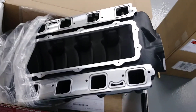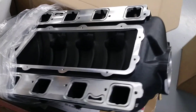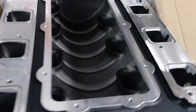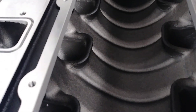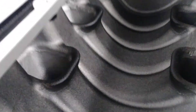What is happening everybody? For you guys that have not had a chance to see the inner workings of a Victor EFI intake manifold for the Gen 3 Hemi, I want to kind of take you guys on a quick tour. This is with the belly pan off of that intake manifold. Nice long runner design — you can see how inside the plenum, how that air is channeled in the plenum to the intake port on the cylinder head.